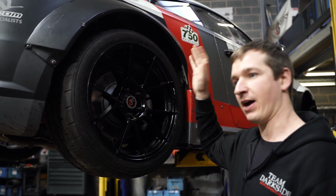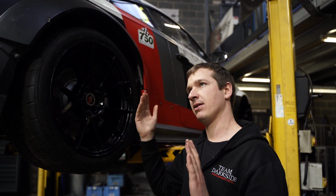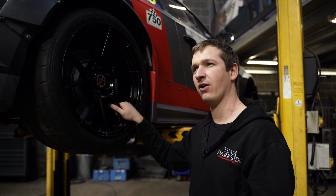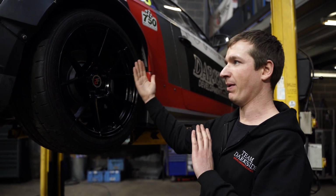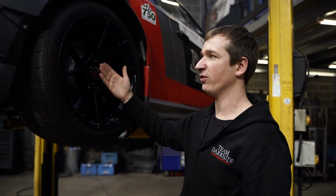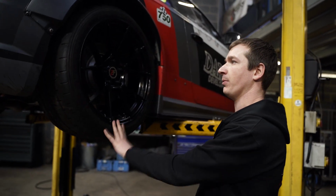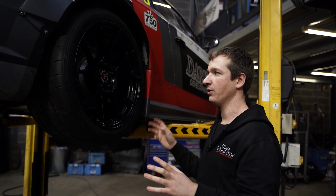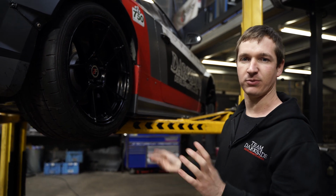These wheels, the offset that I calculated that would work, were going to be basically the same. If we didn't take the spacer out, it'd be in the same place. I think it's from ET44 on the 9-inch to an ET32 on the 10-inch, which puts the backspace in the same and just brings it out the full inch basically. And obviously we took the spacer off, so we're sticking out a bit more. So I think roughly we're probably poking out about 10mm more without the spacers, but when we measure the track up again, we should be able to put a small spacer back into the rear. The front were quite close, but it's all up in the air at the minute. We'll drop it down and have a look.